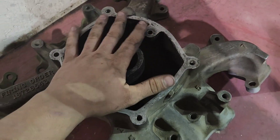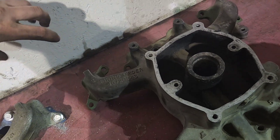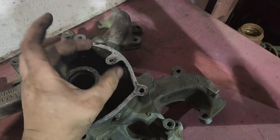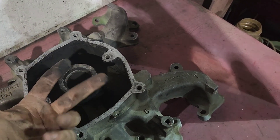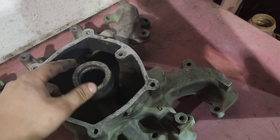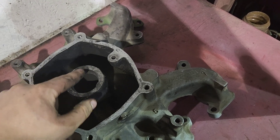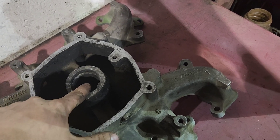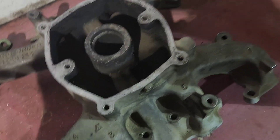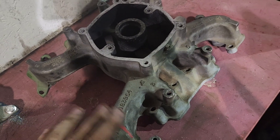The S-Vin — same thing, comes up and over to your turbo — but it has a port in the top for the EGR valve. And in the bottom of the S-Vin there are two ports with a similar channel that runs in your upper intake, with two openings. So when your EGR valve opens, it lets exhaust come from that port, through your upper, and down in. That's how the EGR system works on these — it runs off vacuum and a couple solenoids.